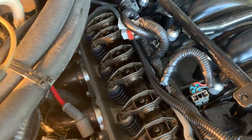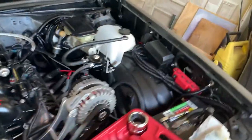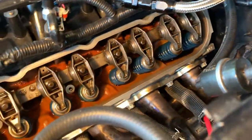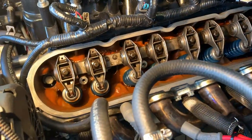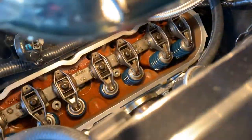I got lucky — it's on the driver's side and I can get to that bolt over here. I can get to it on this side; I just removed the intake and all that stuff, and I can get to this side and torque it down. I'm going to get a new set of torque-to-yield bolts, a new gasket, and we'll get this thing fixed.